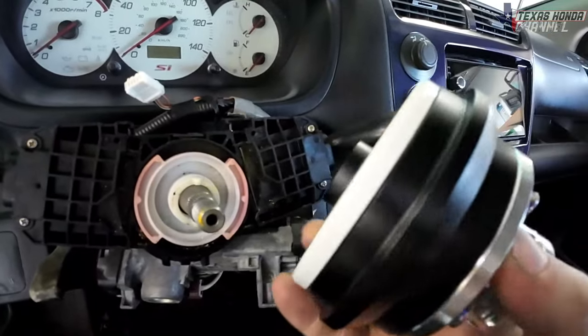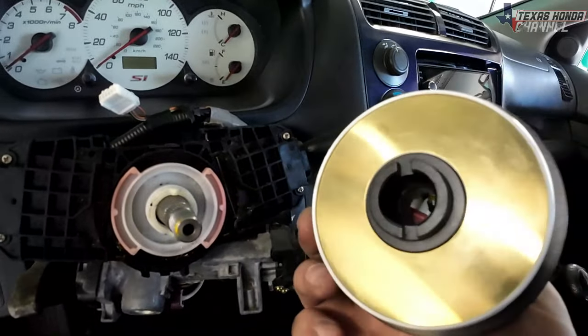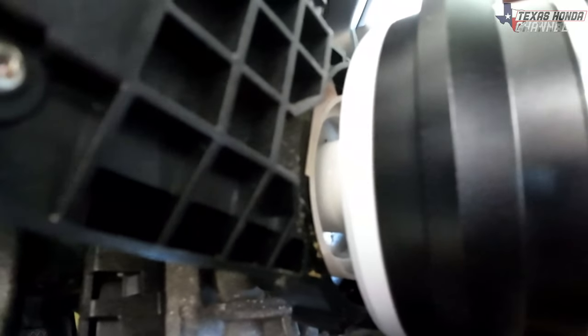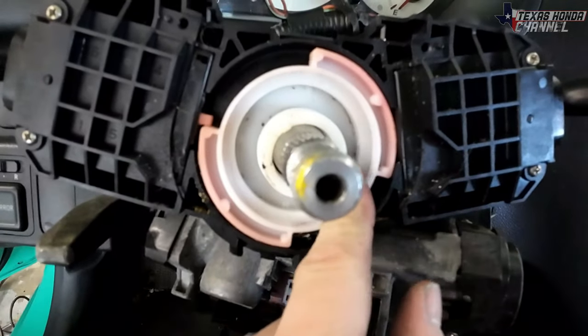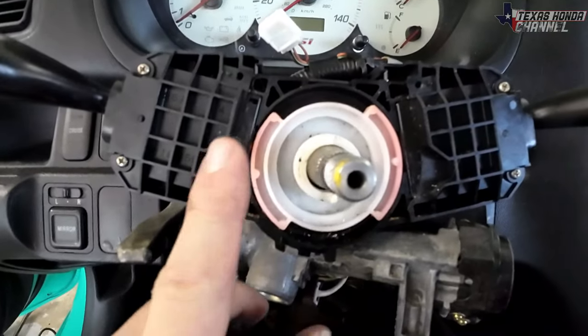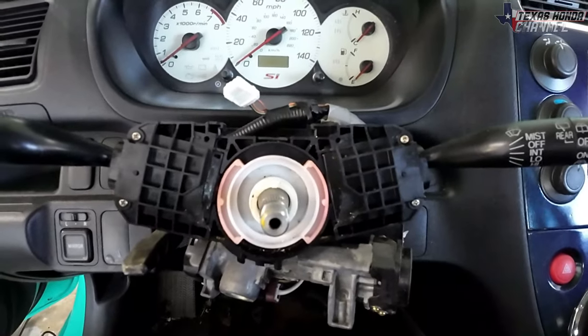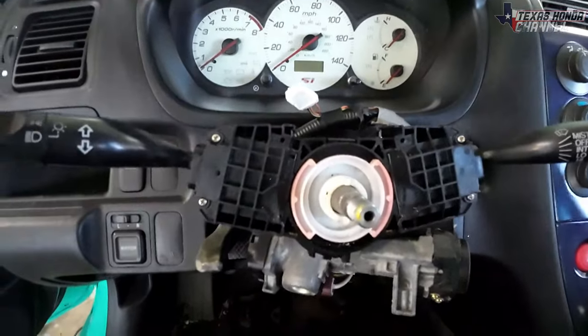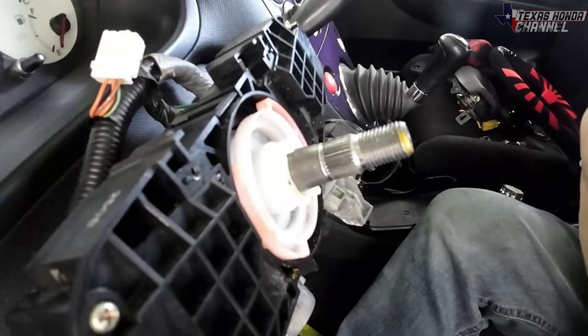I'll link this hub adapter in the description — it's not an NRG one, it's just an off-brand one, but it seems really nice quality and it was pretty cheap. We're going to slide that on — you can see those notches line up with that piece of plastic back there. That piece of plastic is the turn signal canceler. If we turn this you can see it, and when you turn back it shuts that off. We want to keep that so our turn signals automatically shut off, because I've seen a lot of Hondas where they don't do that and it's really annoying.